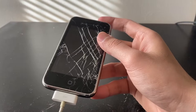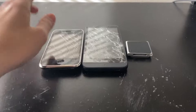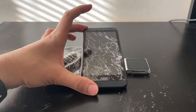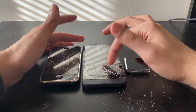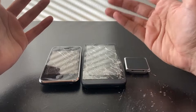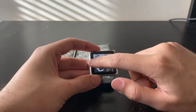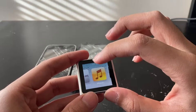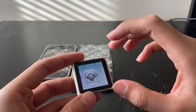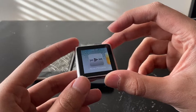So that's it for this video, but let's have a recap of what we got. We got three devices: an iPhone 3G — water damaged. HTC Desire 510 — display is short, not going to fix it, it's not a valuable phone. Display prices were in the $20 to $30 range and I'm not going to spend that much on a phone that's probably worth $2 on eBay. So those two are just going to sit there. The iPod — the battery is holding a bit of charge but it's dying really fast, maybe 10 minutes off the charger. The battery is pretty weak so we'll do a replacement battery on this — they're pretty cheap, like $5 to $10. Stay tuned for that.